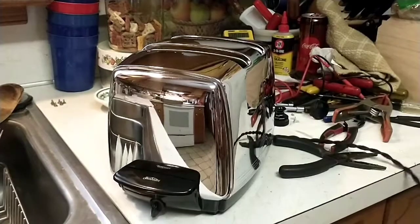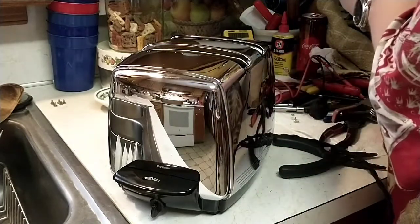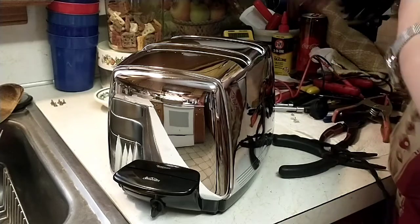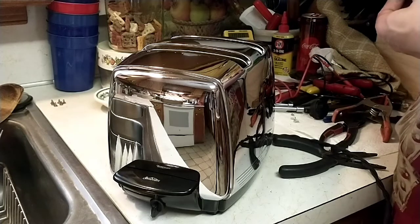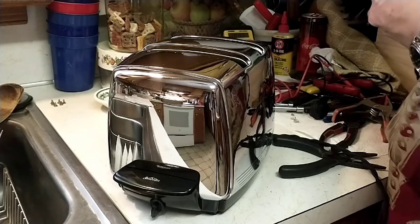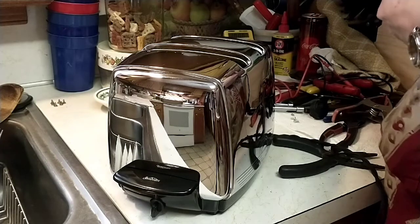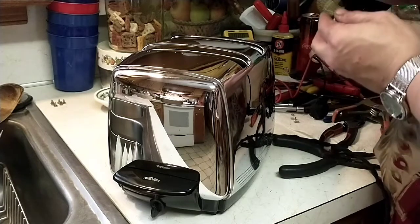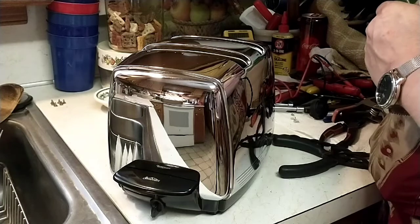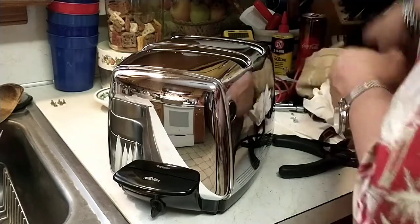All right, so all that's left to do is put the plug back on. Always remember to put this on first. Side we marked as the hot, and which one we didn't move, which would be neutral. You see, I tin the tips of these wires too. I don't like seeing fraying wires and switches. I just think this takes 10-15 seconds to tin the wires once you get used to doing it. And having been in antique lighting for so long, it doesn't bother me to have to do that.